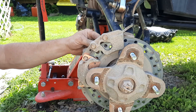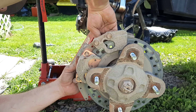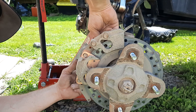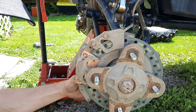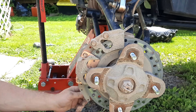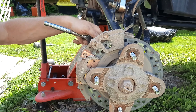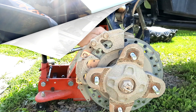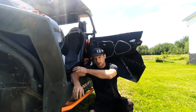Now we reinstall our new pads. Always clean your brake pads before putting them in — just make sure there's no grease or contaminants on them. Putting them on is just the reverse of taking them off: get them set in there, push the bracket over to one side, get one side in, then come over to the other side. Generally they go on real easy.